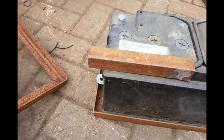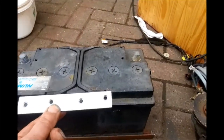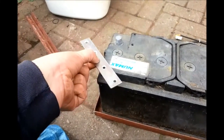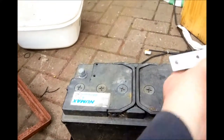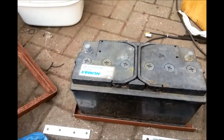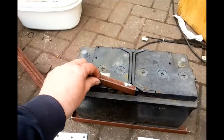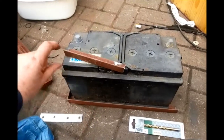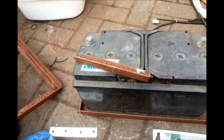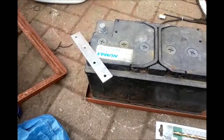I'm going to need some big washers inside the van floor. I couldn't find anything suitable but I found these strips — if I drill all in the center, that will go in the floor at that angle and spread the weight out, one at each corner to strengthen the floor. The carpet's got about an inch of foam under it so it'll compress the foam and be fine. They're not going to show at all.